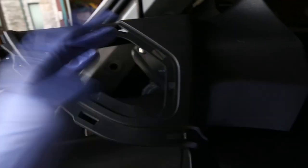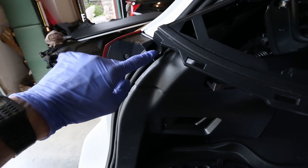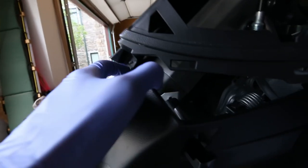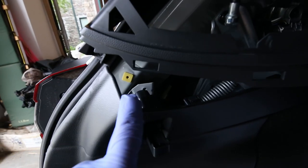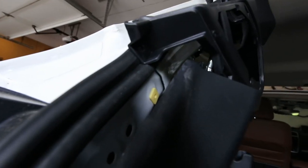Camera transition. Wow. Okay. So this driver's side piece here gave me a bit of an ordeal, because it took me and all my blazing brilliance quite a while to realize this screw right here was holding everything together. So this sits up like so. What you have to do is, you've already taken out this screw. Again, like on the passenger side, you take your bike tire pry tool or plastic pry tool, whatever you have, pull this up, and then this Phillips head screw goes right into this hole. So you just take your Phillips, come straight through here, loosen it a bit, hold this out, try and take it out that last bit with your fingers. It's a little tricky just because of the shape of that opening there.